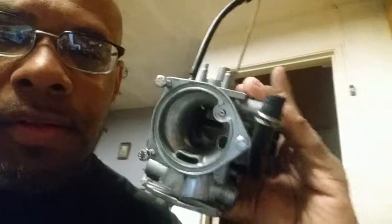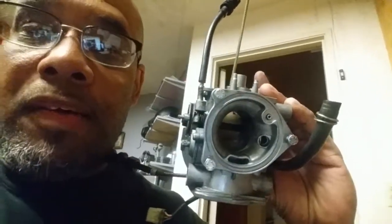Here's the carburetor. The first place I put it was in front of the carburetor. See that hole in there? It fits, but it pops out — that's not where it goes. What I did was stick it down in there even further, and it stuck and stayed, and my carburetor would flood. Because even though it looks like that's where it would go, that's not where it goes. It's a fuel strainer, not an air strainer.